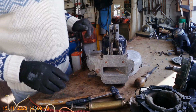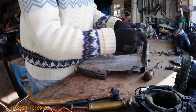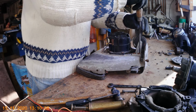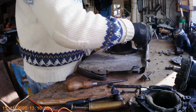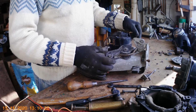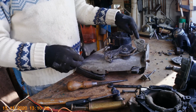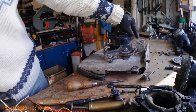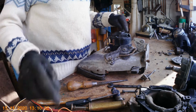do it, undo this bolt here that goes through the handle socket. You undo these 2 screws, take that off, watch you don't lose the screws. Now that should pull away. Now be very careful with this piece. You don't have to remove that to take the motor out, and my advice is to leave well enough alone. Don't try taking it out. They're very delicate, these, and they break.